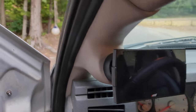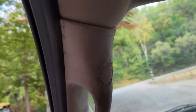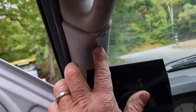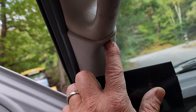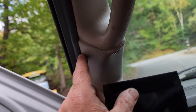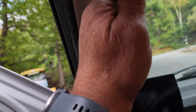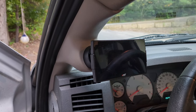The one thing I'd add for someone trying to install this: as you can see, there are two bolts that hold the handle down so it holds firm when you grab it. There was a long bolt to replace the short bolt that goes through, and the plastic piece is the only support. So I made a longer piece so that the bolt rests against it, giving a solid connection to the frame — so when I'm pulling on the handle it's not relying on just plastic to hold my weight.